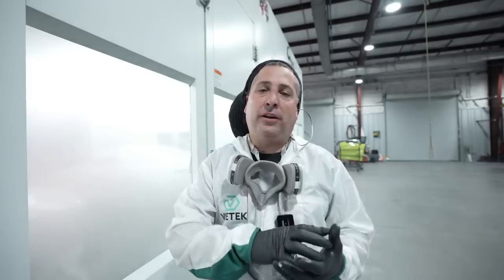All right, so we put 2 coats of the white on, and now we're gonna go ahead and move into the mid coat, which is the pearl. That is mixed in the water base 490, which is a base coat clear. And then you'll add in your pearls and you'll give it the 3-stage effect. So let's go ahead and hit it with our pearl.